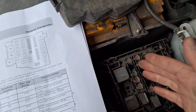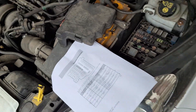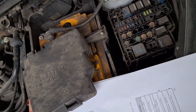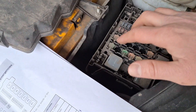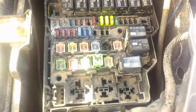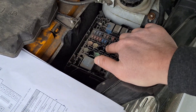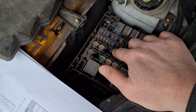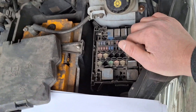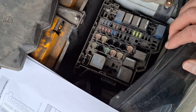One of the first things to check is this fuse for the relays. If it's blown, replace it and see if it keeps working. If it still doesn't work, there may be a problem with electrical connections, or the fuse box itself could be the issue. If you see that the fuse box is very dirty, contaminated, or has a lot of corrosion on the terminals, it means the fuse box requires replacement — this wasn't uncommon on the Fiesta MK7.